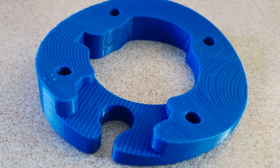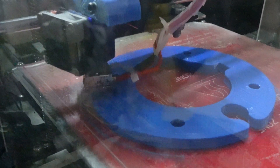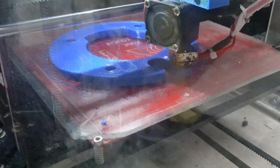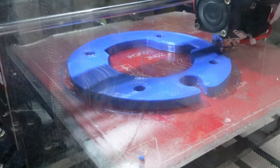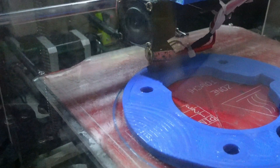The STL files are also on this project's GitHub page. If you don't have a printer, you can use sites like PCBway to upload the STL files and order the printing. These brackets must be strong, so I printed them solid inside — I mean with 100% fill.